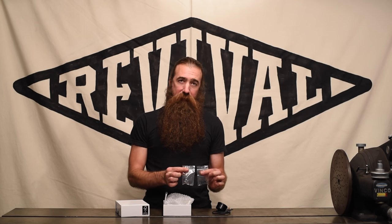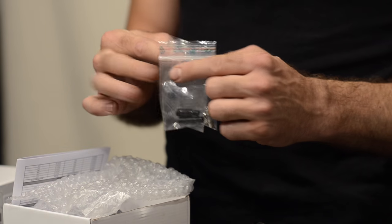So that's the gauge, and we can take a look at the other things you get in the box. The first thing we pull out are a couple of fuses. These fuses are important because they will protect these tiny little wires from lighting on fire if there's an inadvertent short, and they'll also protect the gauge if something weird happens in the rest of your electrical system. Please put these in — they're a very, very good idea.